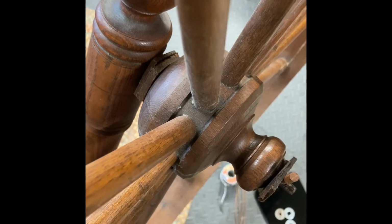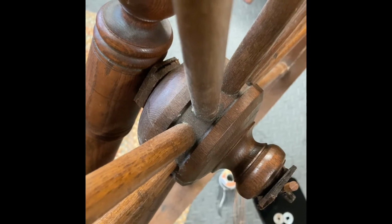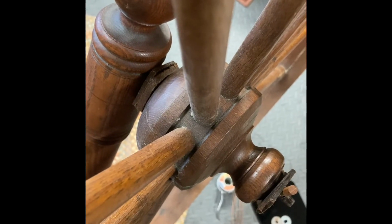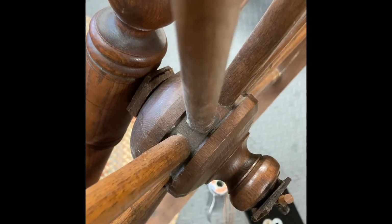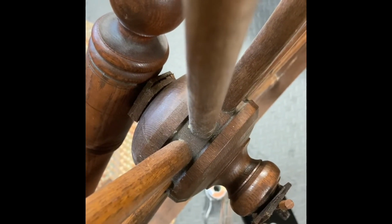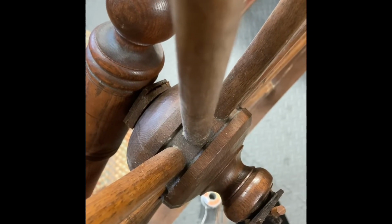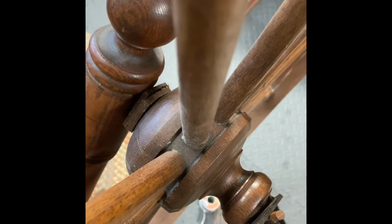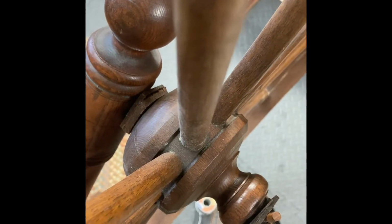Looking at some more problems of the great wheel called Phoenix that I restored last winter. Whenever I purchased it, I really thought it was just going to be spare parts. Here I've had to make leather washers again. The wheel is obviously not original to the entire wheel base. It originated from New York. Here, leather washers even out the axle.